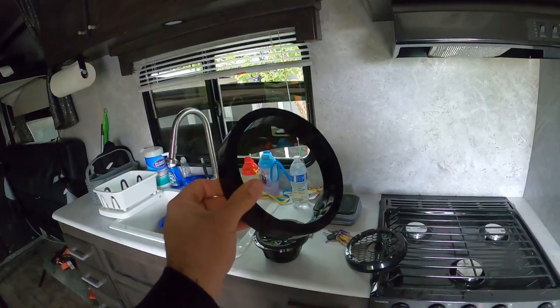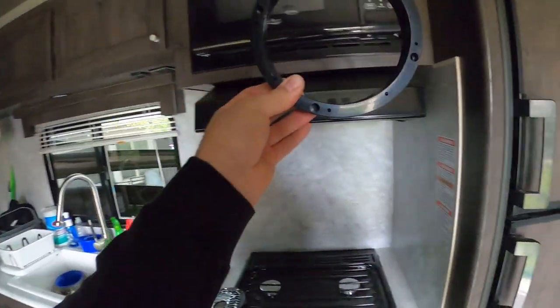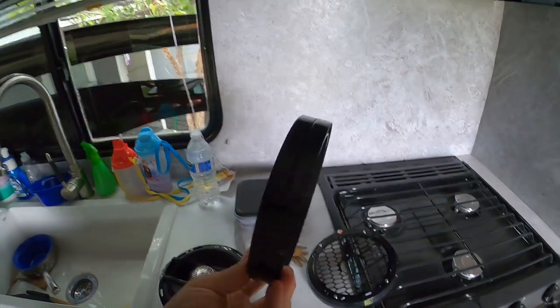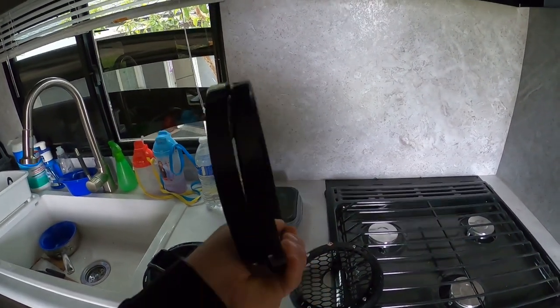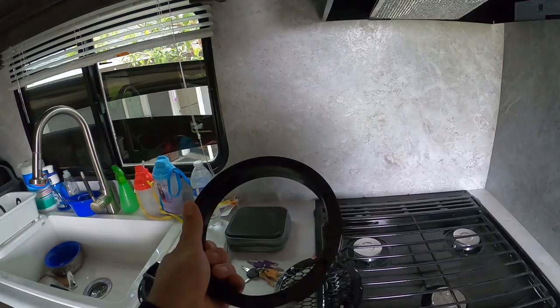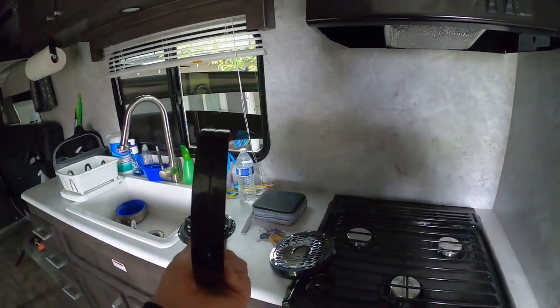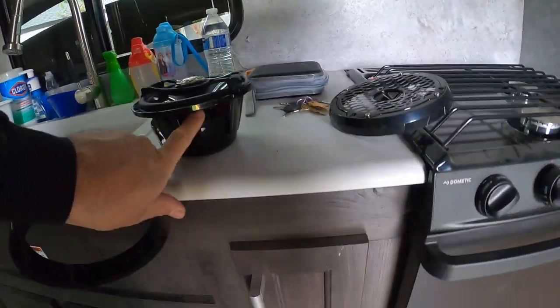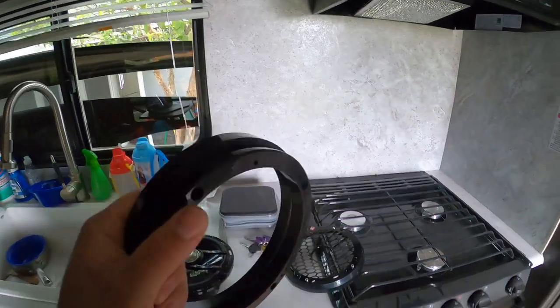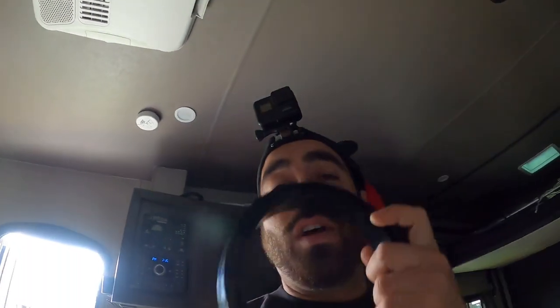Once you remove your speaker, you're going to want to use your spacers — I'll link them in the description — against the wall of the toy hauler where the old speaker was, using it as a template, because we're going to have to cut and trim a good portion. These two spacers together are about an inch. That's not the greatest idea; you want to use one spacer, preferably one that's an inch — or better yet an inch and a half — because you do need space for the speaker to sit inside the wall. For my case I'm using two half-inch spacers, which works, but I recommend using one single spacer of an inch, preferably an inch and a half, for whatever speakers you decide to go with.